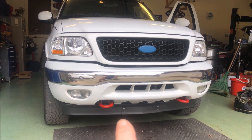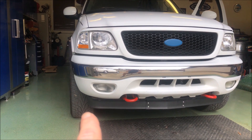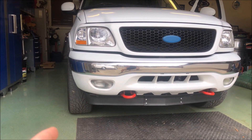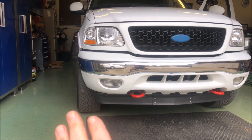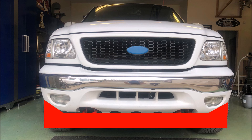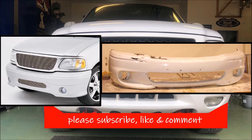Three-tenths of a mile per gallon is not bad, but in retrospect there's a reason why it's not better. If you look at the lower spoiler, it's not quite as deep as modern spoilers, but that's not the biggest issue — you can see where it stops much inboard of the tire. The tires create a lot of resistance, and that's why you see spoilers going all the way across and outside those front tires to direct wind around the vehicle. In the future I might create a custom spoiler that extends all the way across the front. There are spoilers available like the Lightning or Harley-Davidson F-150 spoilers, but they're a little too sporty, so I kind of want to design and mock up my own.